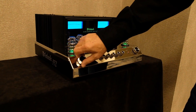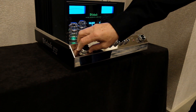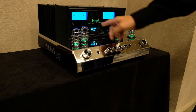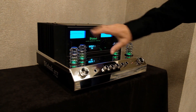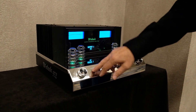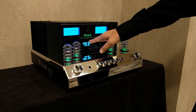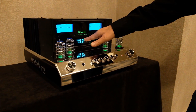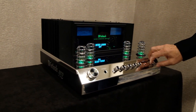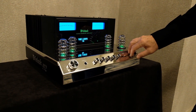You can switch those on and off on the remote or the front panel control. We build in a lot of adjustments here: equalizer on/off, mono/stereo, output one or output two — you could have them both on, or both off and just use the headphones. Each input, like all our preamps, can go up or down six dB relative to each other so you can balance the volumes. Meter lights on, meter lights off, tube lights off, tube lights on.